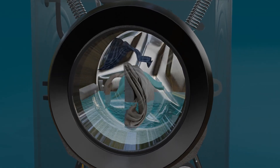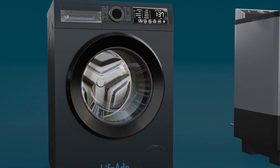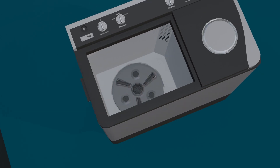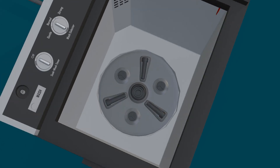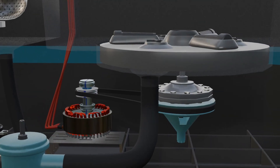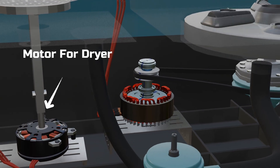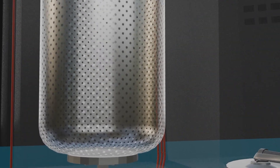That's precisely what washing machines are engineered to achieve, though top-load and front-load models do it in different ways. If you've ever looked closely, you'll notice that the drum in both machine types rotates forwards and backwards during the wash cycle. In a top-load washing machine, there is a pulsator positioned at the bottom that rotates the clothes back and forth. A motor located beneath the pulsator provides the required movement. In earlier machines, universal or induction motors were commonly used; however, modern washing machines now prefer BLDC motors. These motors rotate the pulsator directly in both directions — clockwise and anti-clockwise — with the direction changed by modifying the phase sequence, a task handled by a dedicated controller.